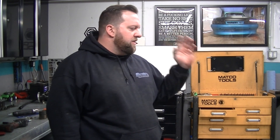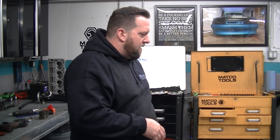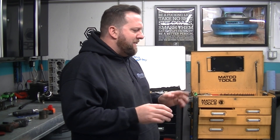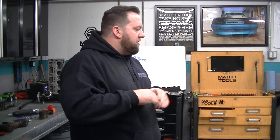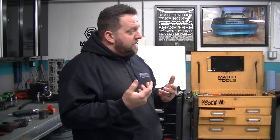I'm not changing the turbo kit or the hot side — just the downpipe. I'm not touching the bottom end unless I find an issue; I'll pop the pan off and check the bearings but I doubt it — I don't hear anything and oil pressure is mint. Not changing suspension, not changing brakes, not changing brake lines, not changing anything in the rear end.